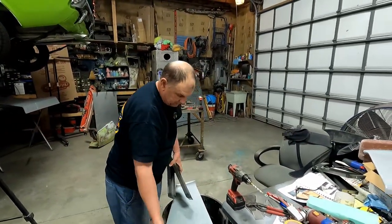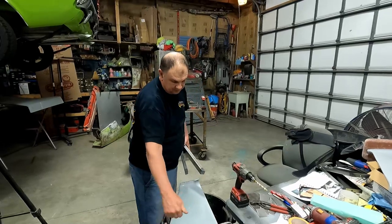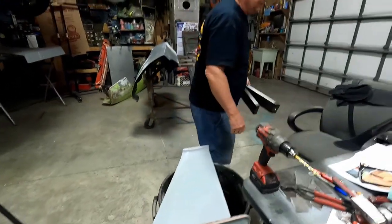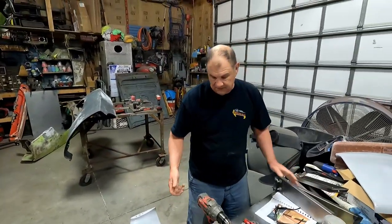And it also says when you put that underneath, you put panel bond. Oh, well, panel bond both of those, as well as panel bond that to the underside of the quarter. He said that'll keep it from possibly making noise and squeaking in your trunk.